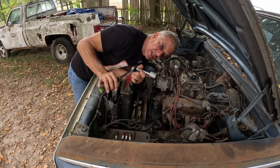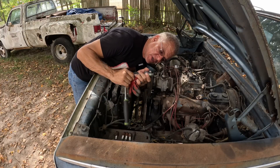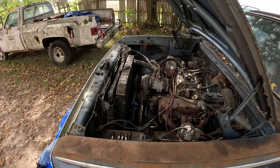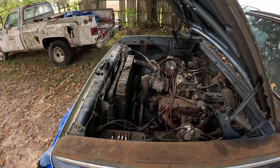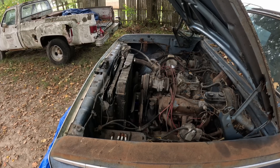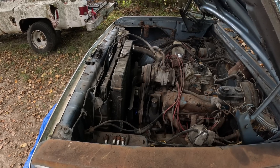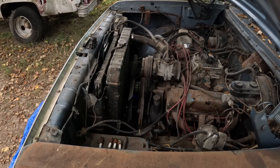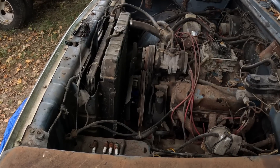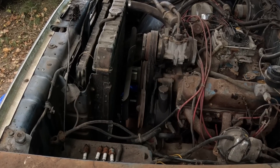It's all lubed up. I'm going to jump under the truck and start cranking this over with our big wrench — it's like an inch and a quarter, a huge nut on there. The only problem with having a solid-mount fan is it wants to get in the way. Fortunately the fan is loose enough I can just scoot it back and start over. The Marvel Mystery Oil is definitely helping — I can feel it loosening up already. I'll give it a couple revolutions, get everything oiled up real good, then put the battery in and see if she'll spin with the starter.